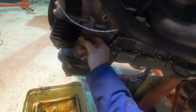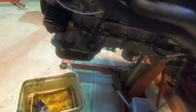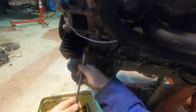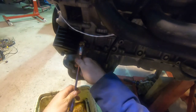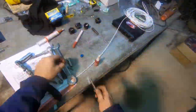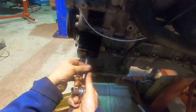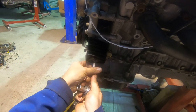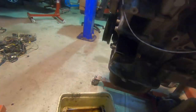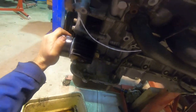That's looking pretty good. Refit the oil pressure sender — whether you're using a switch or a sender or whatever unit you're fitting. This one's getting a pressure sensor; it's going into a race car and that's going to be the only sensor running to the ECU. I'm putting this on so I've got the exact unit that the race car has got on it. With sealant on the blanking plug, that can be screwed in. Refit an oil filter to it — I'm using a short oil filter on this particular one, and of course lubricate that surface.